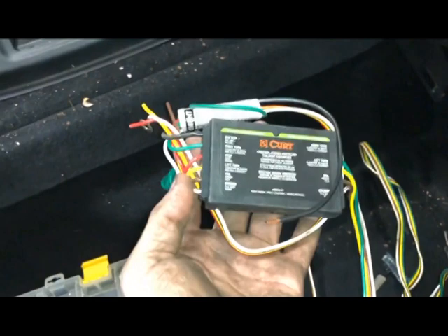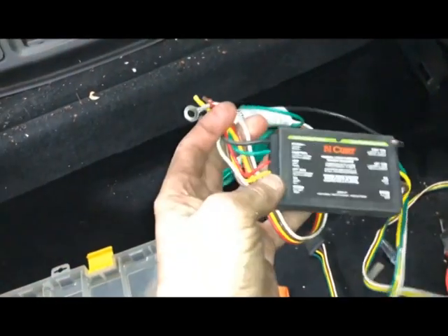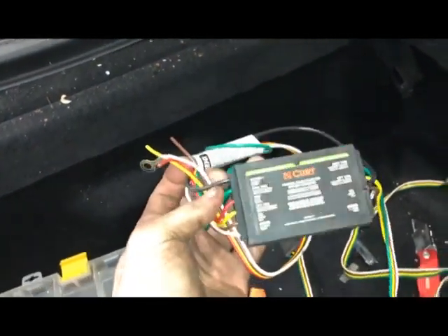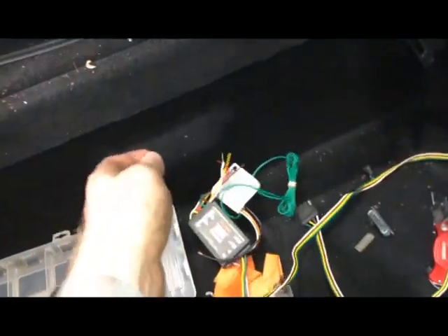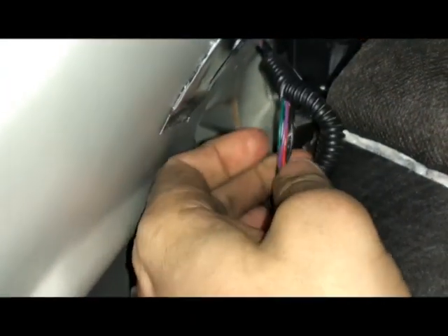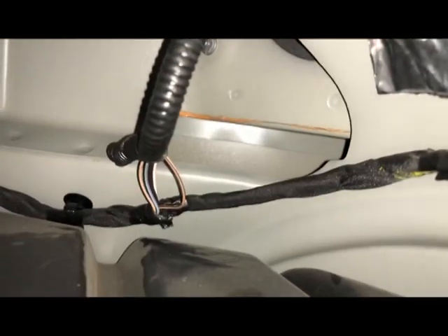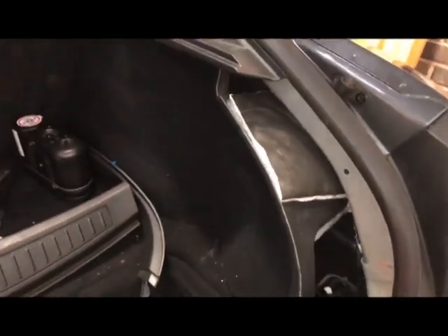I've got this powered light controller that I never wired into the Fiat. I'm going to have to find either ignition-switched or constant 12-volt wires back here, which is going to be a little tricky. The only other DIY I found online, the guy just ties it in with no relays, which I suppose you could do. The wires to use are purple, purple-green, and black on one side, and taupe with black on the other. The subwoofer is massive — anyway, I'm going to pull this carpet piece out with that T25 and try to find power at the amp.